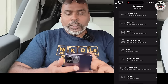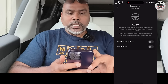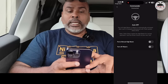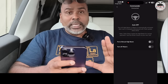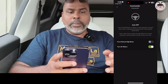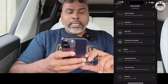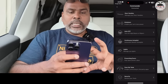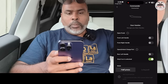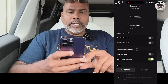In addition to the buttons, the commander module has built-in features. You can have high beam or wipers turned off automatically — force manual high beam or force turning off wipers if automatically activated after autopilot starts. This is the bug that has been bugging me all my life, and I'm definitely turning this on. It will force an auto-off of the wipers when autopilot is turned on — the most important reason I bought these SEXY buttons in the first place. You can also configure presenting doors and other features.